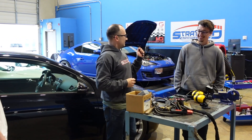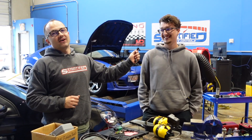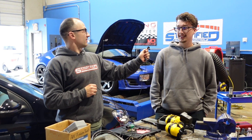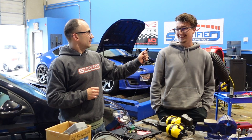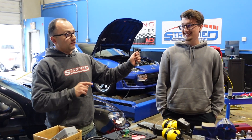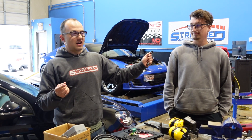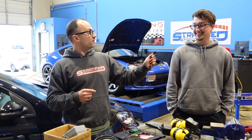Your guess is 299 — is that your final guess? I guess 301. Actually, the car made on the last pull that you just walked in and saw... 327 to the wheels. That kills my expectations — that's way more than I thought. It's actually 50 horsepower more than on pump gas. On pump gas, your cars were pretty similar — we were knock limited. But once we threw in the ethanol, we were able to add another 50 wheel horsepower.